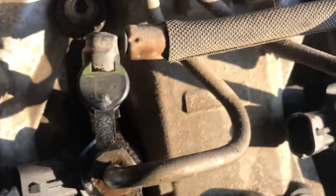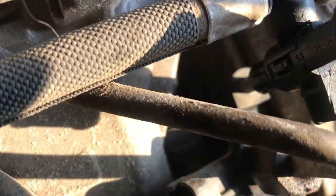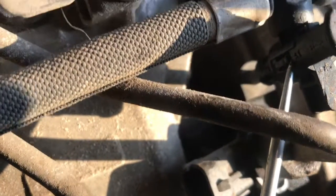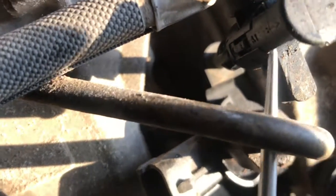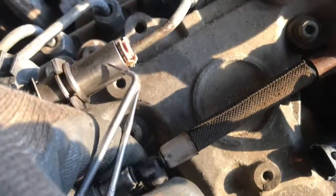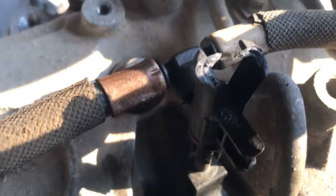The return lines — right there. There's a little tiny clip or pin; you have to pry that out just a wee bit, not too far so it doesn't break. Then this top piece has to pry up, and then it can slide off of the injector return. Once it's slid up like that, you can pull the thing right off, but it has to pry apart like that. Not like that one there, which I just split all the pieces.